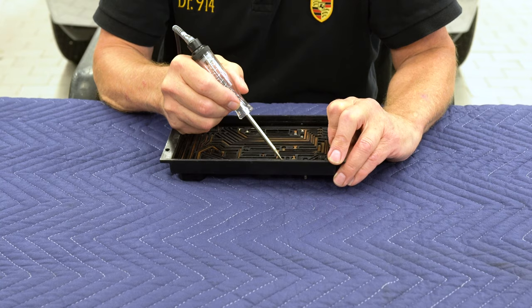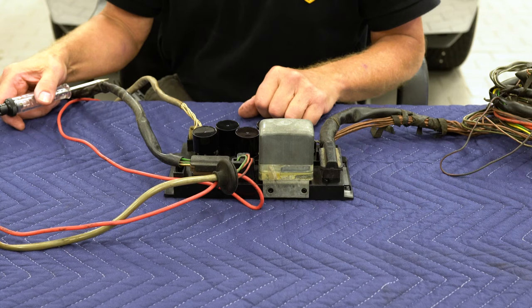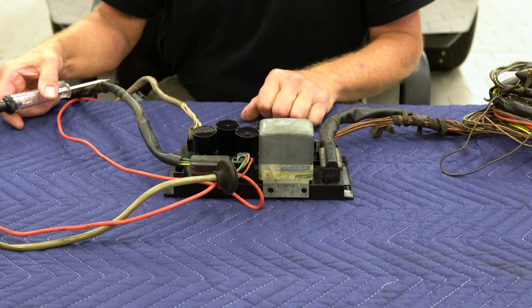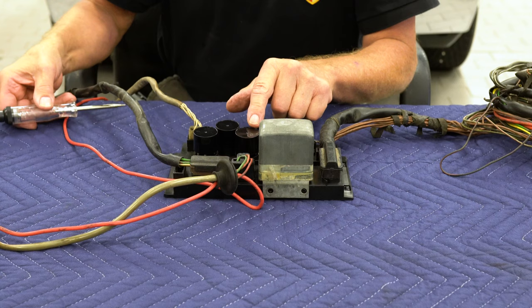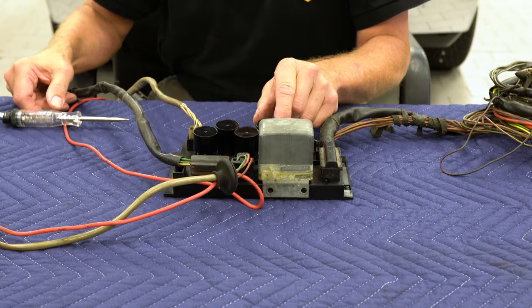Next, I'm going to show you a fully loaded board. Here is the fully loaded 1.7/2-liter relay board. A little daunting when you take the relay board cover off and look in and see all of these gizmos, but you've already seen it stripped, so a little less daunting now. Four relays like we'd spoken about, and notice these relays have no notation on the top. These are aftermarket relays that I purposely plugged in here to show you the difference — made in China, and truly aftermarket, and sometimes can't be trusted.